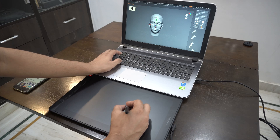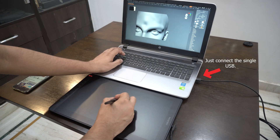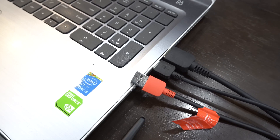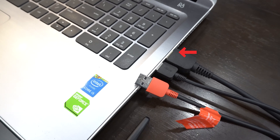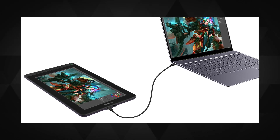If you ever want to use this tablet as just a pen tablet and not a display tablet, you can do so by powering it off and reconnecting it to the laptop via a USB cable to activate the pen tablet mode. This might save your battery on the laptop if you ever need it. I tried hooking the tablet to my laptop and just the HDMI connection and the non-powered USB were enough to power it on. Just imagine the convenience of not plugging the tablet into a power outlet, saving you the trouble of extra cables.